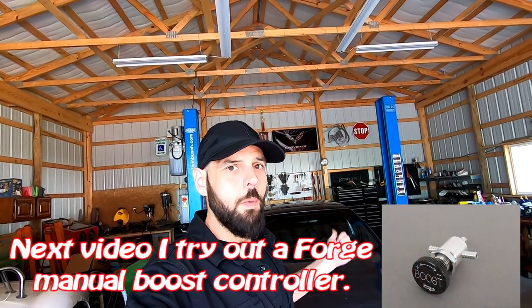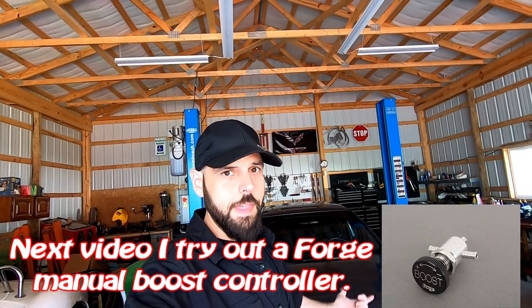I'm going to end this video here. If I figure out something else, I'll do another video on it, or I might convince myself I'm chasing a ghost — but I like to figure out what's wrong. Another video coming up is going to be adding methanol. I noticed in winter the car had very steady boost pressure, but now that it's really hot out, the boost has been fluctuating — it could just be temperature related. I'm not trying to bandaid a problem; I want to give them added security. I'm going to do more research, maybe get a better manual boost controller with the right diameter fittings that works with the N75 valve. The nipples on this one were really small — about smaller than an eighth of an inch — versus roughly a quarter inch on the car. That might be the problem.